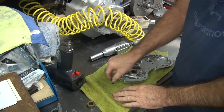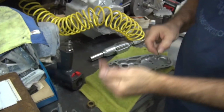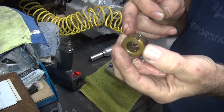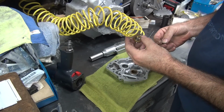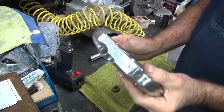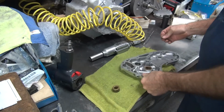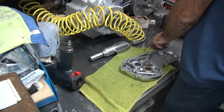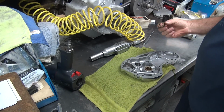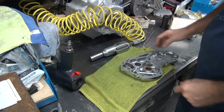Okay, a little pin came out, a little dowel pin. Don't lose that. That pins the bushing, so the bushing can't rotate. That's that's job. You see how deeply they drilled that thing down in there. Pretty deep. Alright. I always put the pins in one spot up on the bench so I don't lose them. So this is our old one. Not using that no more.